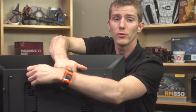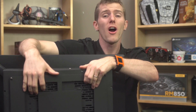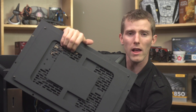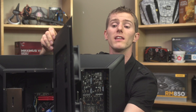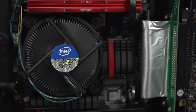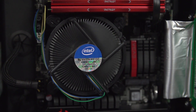Opening up the system is actually quite simple — just remove the eight knurled thumbscrews on the back and you can pop it right off. The first thing I noticed is that those 120mm fans are actually Cougar fans. The second thing I noticed is that the back has a nice decorative Crate Computers logo on it that is also protective — it separates the fan intakes from any obstructions behind the computer, ensuring there's always enough of a gap for airflow. The third thing I noticed, unfortunately, was the use of a stock Intel cooler. Ouch. Inside a small case like this, I'd at least initially question the wisdom of that, but I'll let the performance tests tell the whole story.